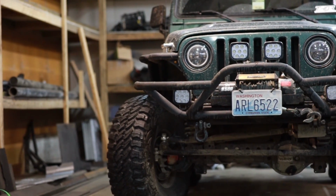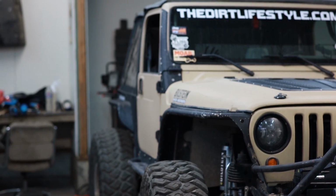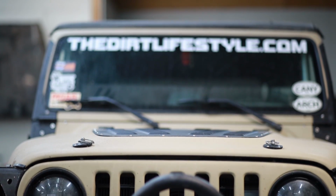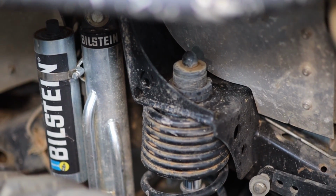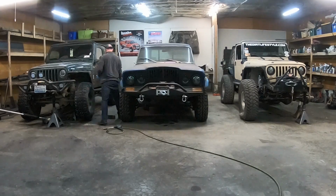When I started planning this video, it was very important to me to do an apples to apples comparison. So I wanted to have two of the same vehicle, one short arm, one long arm. For the short arm, we have my brother's 2001 Jeep TJ with a 4-inch spring and 1/2-inch puck and a 1-inch body lift. For the long arm, we have my 2002 Jeep TJ with a 4.5-inch spring, no puck, and a 1-inch body lift. So they're virtually the same. The only difference between the two is tire size, but when it comes to long arms and short arms, tire size is not really much of a factor.